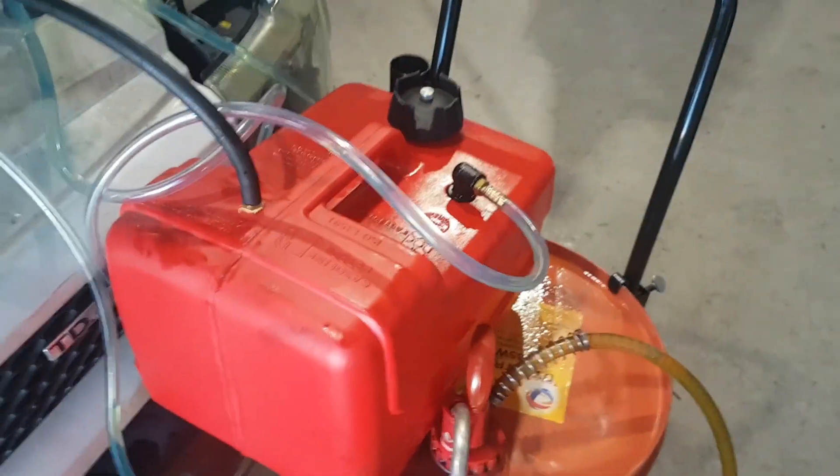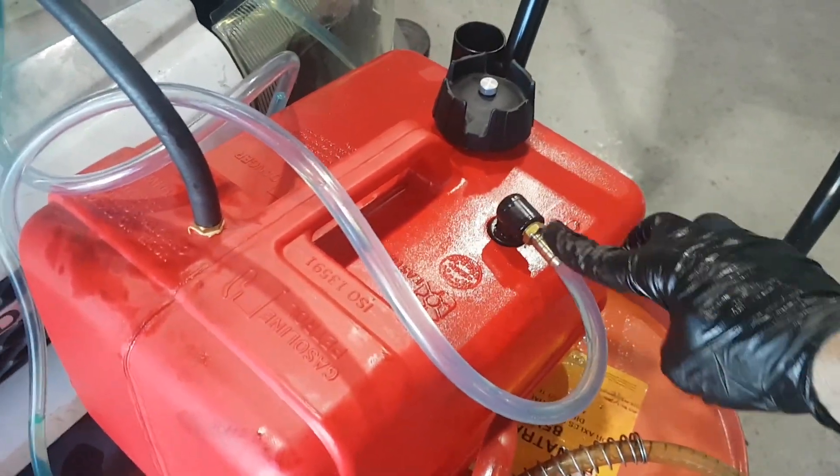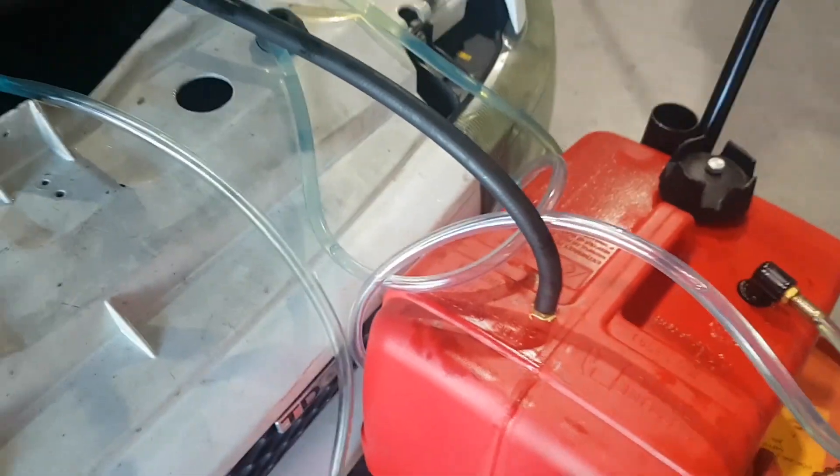So what I do next is I want to know if it's worth going back to the tank. It could be quite a lot of work getting under this vehicle. I want to make sure that if it had good low side supply, we're heading in the right direction. So I use a little contraption I picked up from Clinton Brett from Diesel Help Australia — it's just another fuel tank, essentially a little jerry can. You can make one yourself. We fill this with clean diesel and we've got an outlet up to the fuel filter. I've also got the return coming back from the engine, because it will quite quickly circulate a lot of fuel through the system.